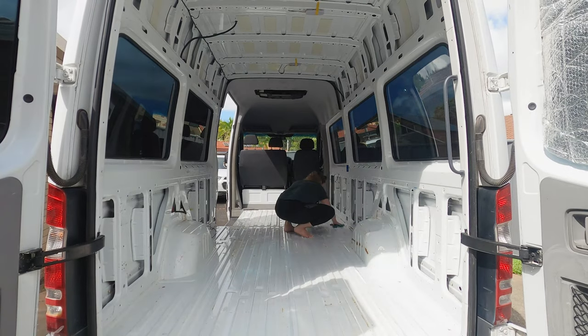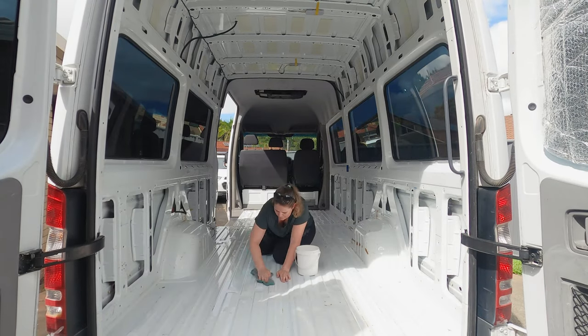Okay so I've fully cleaned out the back of the car. We're just aiming on the floor at the moment, so I've cleaned it out with soap and water. We figured out that we probably need to scrape back the rust a little bit so that any paint that is bubbling with rust underneath it we can get to it all. I'm gonna do that and then move on to re-sweeping it and checking if we need to degrease any of it.